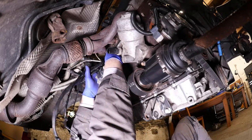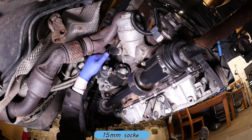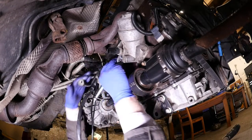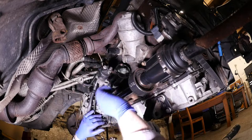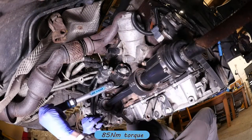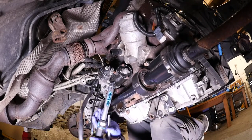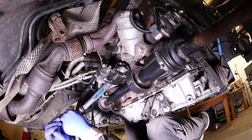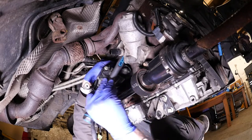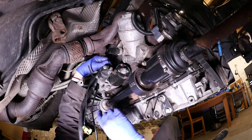There's our oxygen sensor wire again. I'm going to put the bolt in there with the brackets. For the top one you might find it easier to use a flexible head adapter, which is what I switched to in the end. Then we just need to torque those two to 85 Newton meters, which is extremely awkward with an engine swinging away — I was having to use my feet and knees to try and steady the engine to get that 85 Newton meters. There's the click. The upper one is going to be even more challenging — it'll be a lot easier with the subframe.